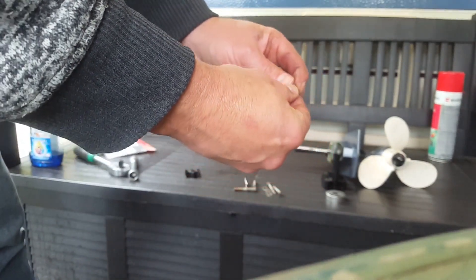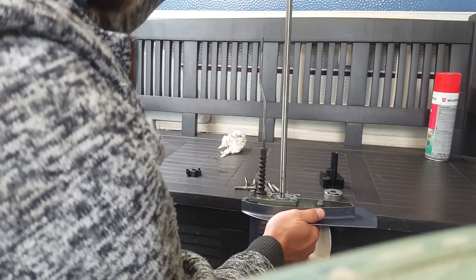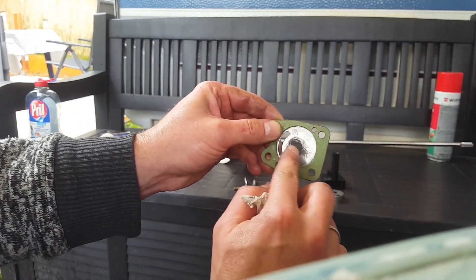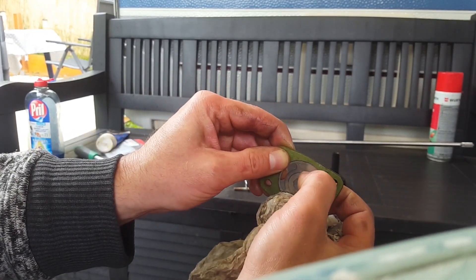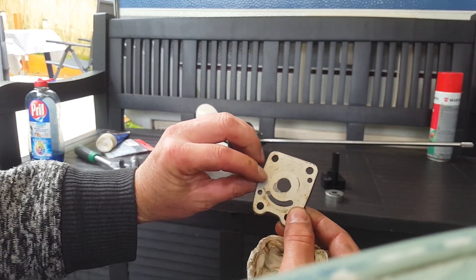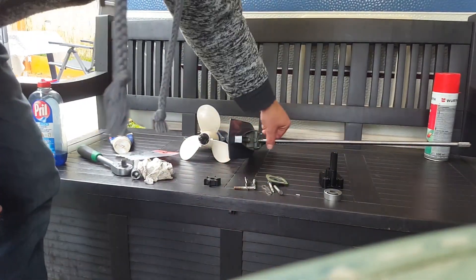Keep an eye on it — it's important. Without this part the impeller is not able to turn. Remove the bottom case and the gasket, and wow, I'm pretty surprised — there's almost no dirt or salt in it, pretty clean. Usually you have a lot of wear in here but there's almost nothing. You can't even feel it. You can see what look like scratches but there aren't real scratches — it's pretty good. I can use it again. I really could reinstall the old impeller, but I will install the new impeller. I'll use soap on this shaft.